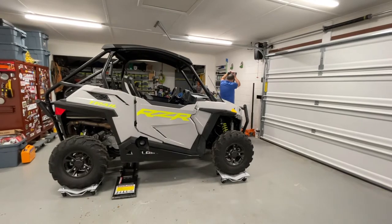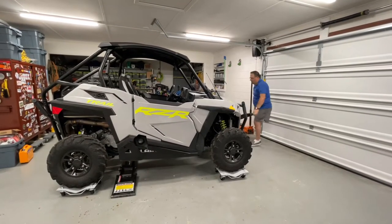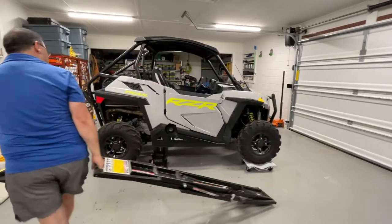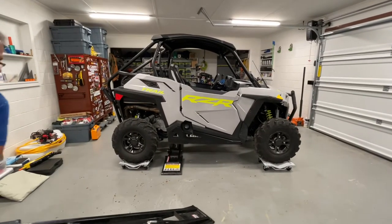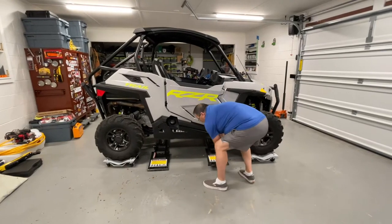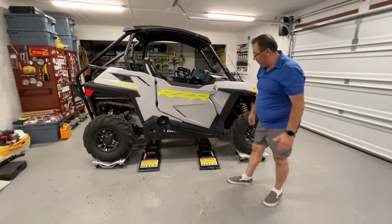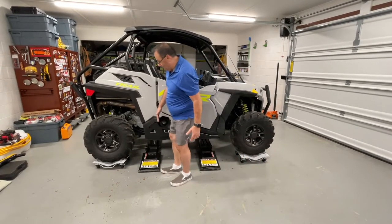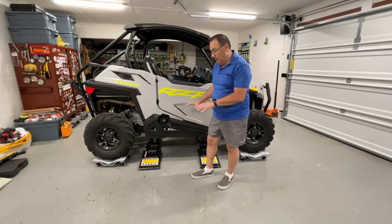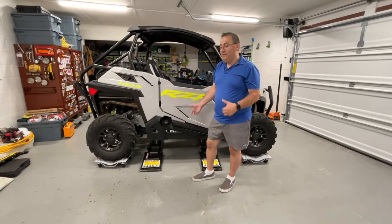He's getting the quick jack out so that we have two and can lift the razor easily. These things are awesome. Now these are quick jacks — these are the 5,000. I love these things. I used them in my car racing days. Awesome to lift the vehicle. Now some of you are asking why I'm not putting them lengthwise — it's too long for a car, and you can go either way as long as they're parallel to one another. So we're going to set those up and lift this thing.